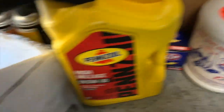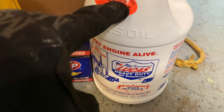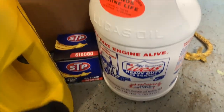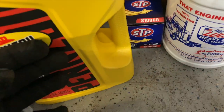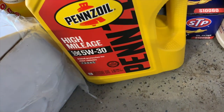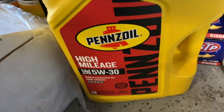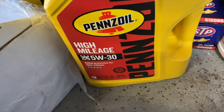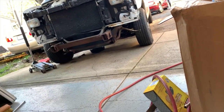I got the oil filter ready. I'm using some Pennzoil and some oil stabilizer. I'll use one and a half quarts of the stabilizer, because anything over 75,000 or 100,000 miles is considered high mileage and you can use up to two quarts of this stuff along with your oil. This van takes between five and a half and six quarts, so I'm going to use one and a half quarts of oil stabilizer and top it off with oil. Those are a couple of tips and recommendations as we get the bumper out of our way.